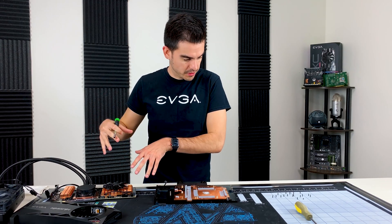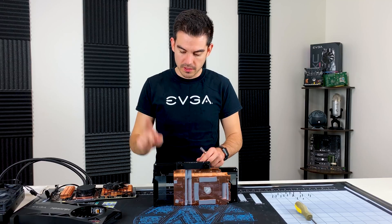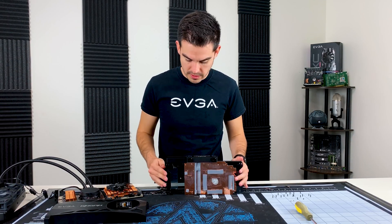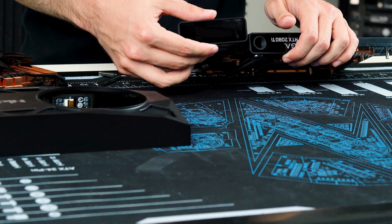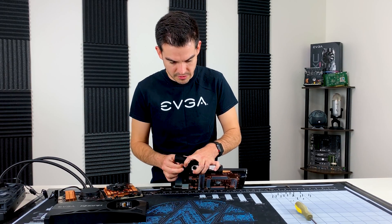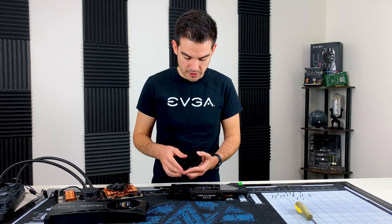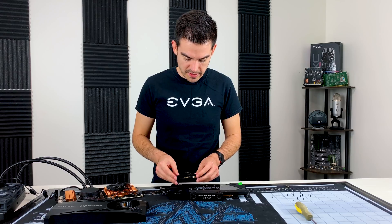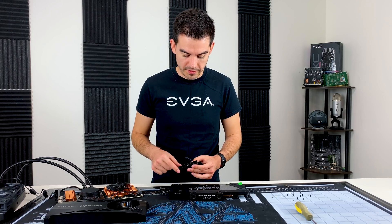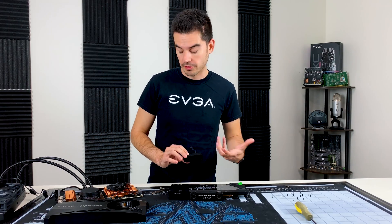I've mostly got the Kingpin back together as a hybrid card and I've turned the camera back on so I can remove the OLED screen from the water block and put it onto the Kingpin card. I've removed the two hex screws that hold on the water block's OLED screen, so it should pop right off. There is an LED connector that goes into the block itself because there's an LED in there, but there we go — that is the module. It's machined aluminum, actually really high quality, and it has the little board that the OLED display needs as a display controller, plus the connector that goes to the card. We're going to connect that before putting on the shroud.